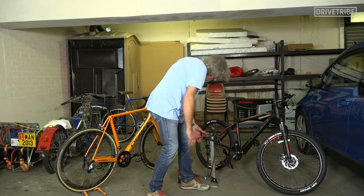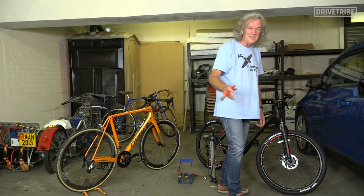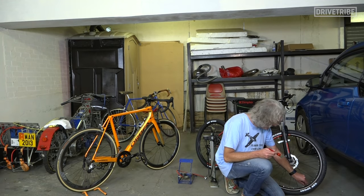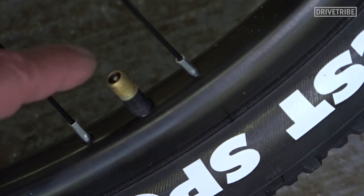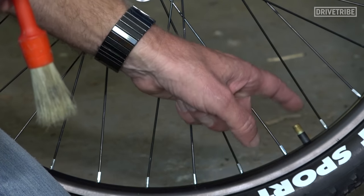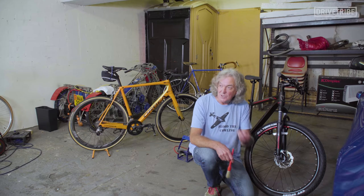First of all, we're going to talk about dust caps. A lot of cyclists are a bit sniffy about dust caps — they sort of think they're uncool — but actually they're an extremely good idea, especially with Schrader valves. If you look at the top of the valve, you'll see it's like a little cup almost where dust and grit and muck will collect, and eventually when you press down the pin in order to put air in, a bit of that muck will go down in there and stop it closing fully, and you'll have a very slow puncture in effect because the valve is leaking.